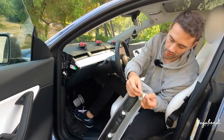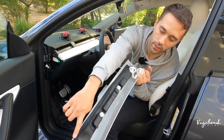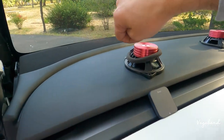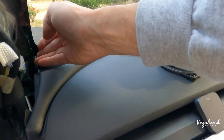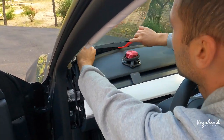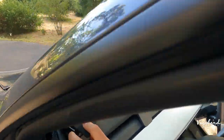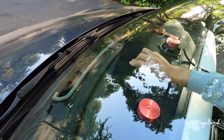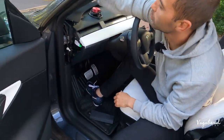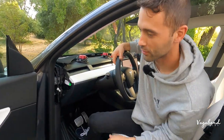What you're going to do to remove this is there are those two little tongues on the right and the left — squeeze them together. This is going to allow this A-pillar to pop out. You've got four clips total — set that aside. That opens up to the mid-range cover. The reason you had to remove all that is because there's a tongue here that literally sits under the A-pillar cover. Now let's go ahead and remove that mid-range cover. The mid-range cover is slightly removed and it opens up to us the driver side in the middle of that mid-range. We can go ahead and remove that with the Torx screws. Let's go ahead and remove those three Torx screws on each one. They also come plug and play. We're going to remove that speaker and then place one back in.